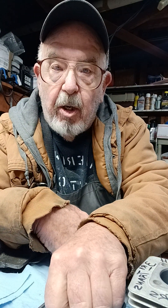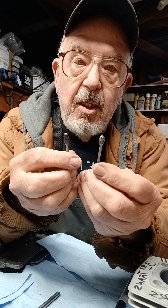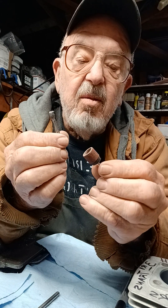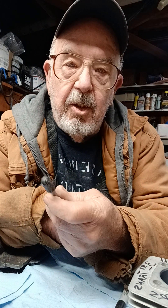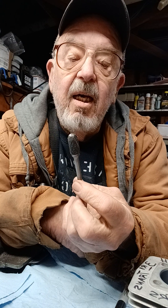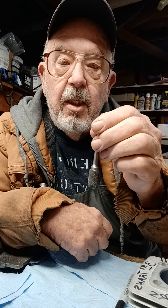This is a good start. If you want to get into this, get some burrs — get the aluminum burrs and the steel burrs. Get a big set of sanding rubbers along with the sanding pads; you'll need a ton of those. Once you've got those all figured out real good, then get yourself a drill press, or a mill if you can afford it, and get a nice big half-inch burr and a steel burr — then you can learn to do a transfer.